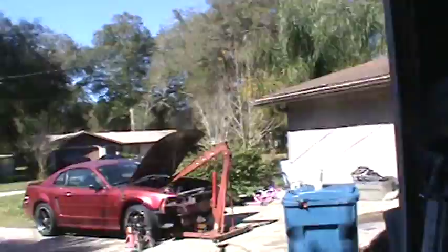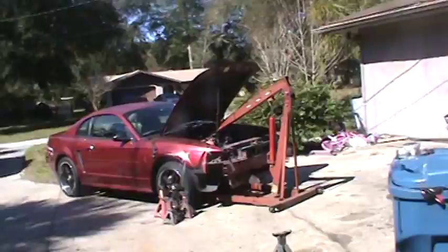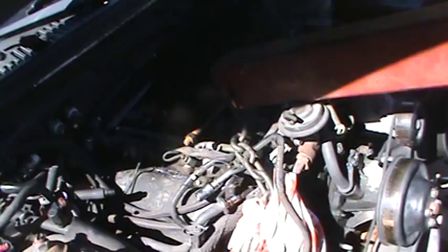It's a beautiful day here in the garage. I've got the Mustang over here — my son's working on trying to get the motor and transmission pulled out all together, and that's not going too good. This motor is a little different than the 96. This is a 2004, and it's got some variable intake geometry linkage on the back that closes flaps off, and it's all jammed up against the firewall. I might have to get involved and help get it out.